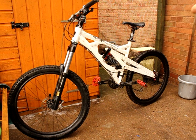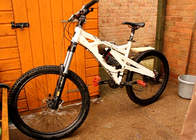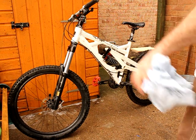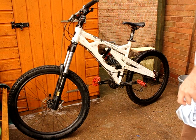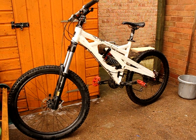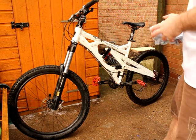So that's pretty much it for basic bike cleaning. This is what I'd recommend you do before you put your bike away, or if you haven't done it before you go for a ride — just to prevent corrosion. I don't recommend plastering the bike in GT85 — don't do it, your brakes won't work, and if you get it on your pedals you'll be slipping off. It's okay if you're going to take parts off separately, say take your derailleur off and clean it in GT85, but don't spray it on your derailleur when it's on your bike because it will get on the discs. So thanks for watching.